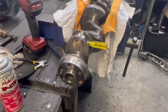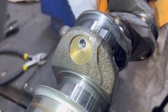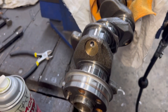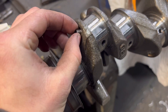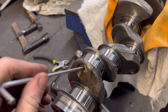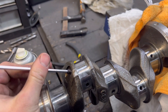Ten thousand years later, we are done. I drilled the hole out to 7.1mm then went through it with an M8 1.25 tap. Just chuck the grub screw in with some Loctite and tighten it up properly. Because we still have to clean everything out I'm just leaving the grub screws out for now. There we go - all nicely tapped.